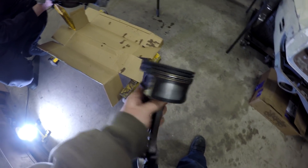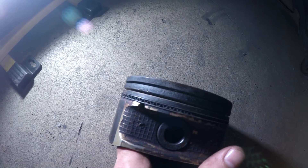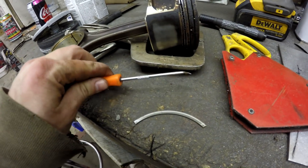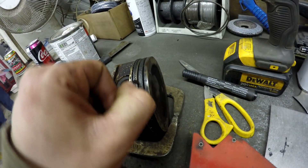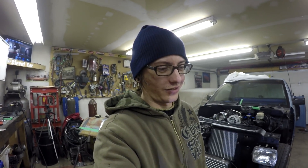This piston from the 6-liter is pretty filthy, but the ones that came out of this engine were even dirtier before we cleaned them. For the piston itself I cleaned it with a brush on all parts including the top and sides — obviously with the rings removed. Once you have the rings removed you can see a whole bunch of crud in the ring grooves, so ideally you want to get all of that out so the ring can fit and rotate properly. We used a pick for the really tough stuff, an old piece of ring cut off to scrape in there, and then 180-grit sandpaper to clean it up.